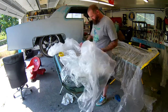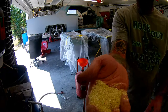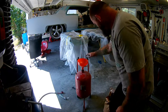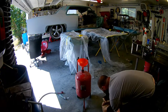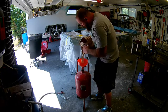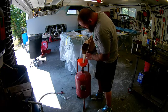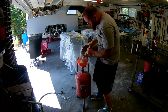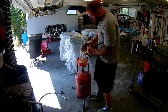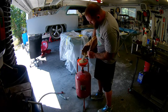If you guys are thinking about getting one of these Harbor Freight pressure pots for your garage or outside — hold on — that's medium grit recycled glass. I can buy it at Clean Blast in Tacoma. It works really good, and it's recycled glass, so you don't have to worry about silica poisoning or ruining the environment. And it's reusable — I reuse it a bunch of times. I'll show you how I do that after I get it off the garage floor. It does make a mess, but I like to reuse it. Cover it up with plastic as much as you can to keep it out of the nooks and crannies of those panels.